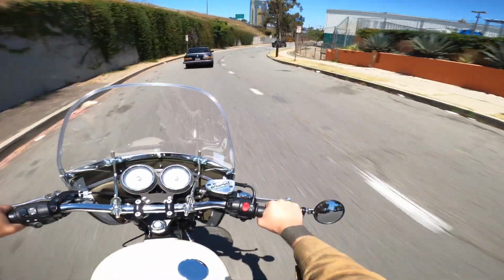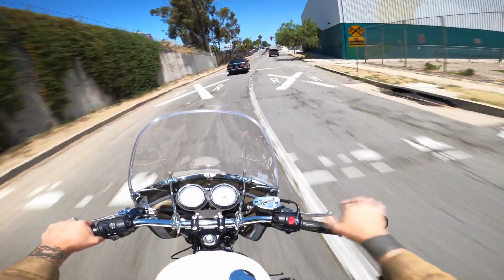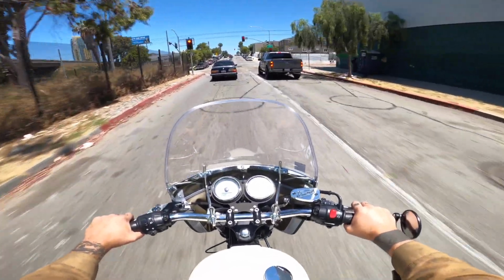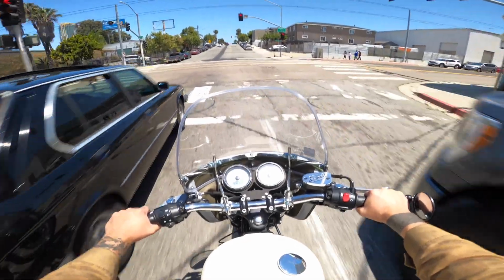It was really rich, and I think it actually got like 10 miles per gallon. Tuning the ECU back to factory tuned helped with that, but it still didn't run right because of the exhaust. Then switching to the TEC bike parts exhaust fixed that. It's run normal ever since.